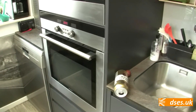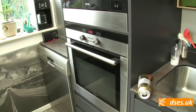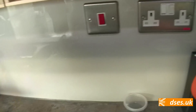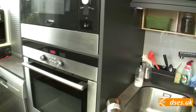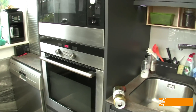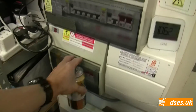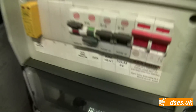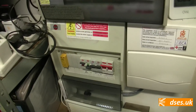Let's change this top element out. To do so, I'll have to extract the oven from its housing. This is usually fairly easy, but first it's best to isolate the bastard. In my kitchen, because I wired it all in, I have a double pole isolator I can use, but BS7671 doesn't mandate such, at least not that I've ever found, and isolation may be required from the consumer unit itself. If neither is obvious, it may be that the oven is plugged into the socket circuit, because your kitchen fitter was a bit of a prick.